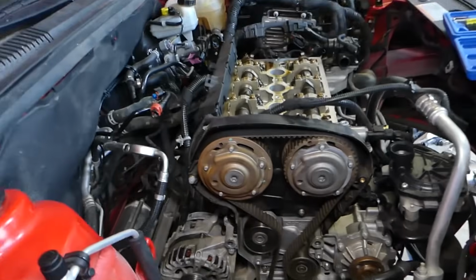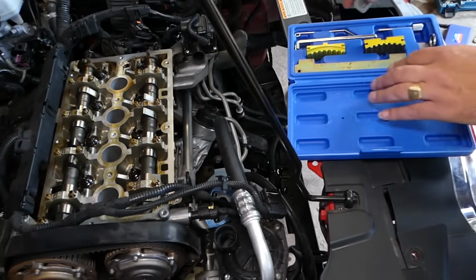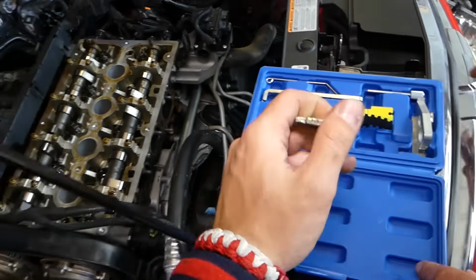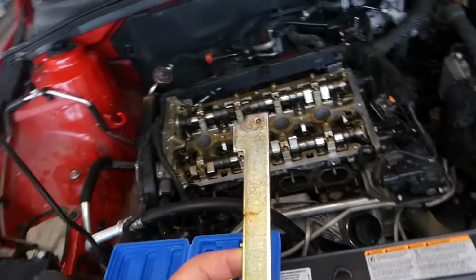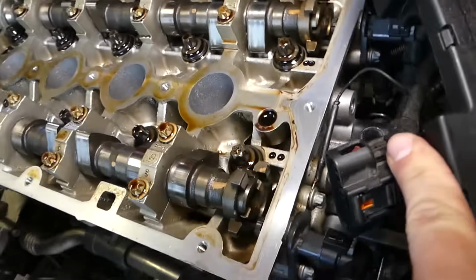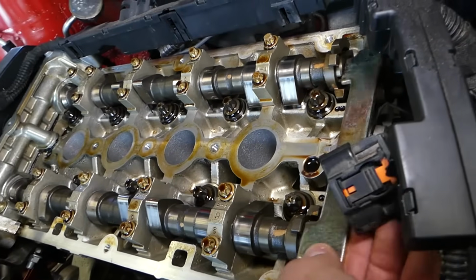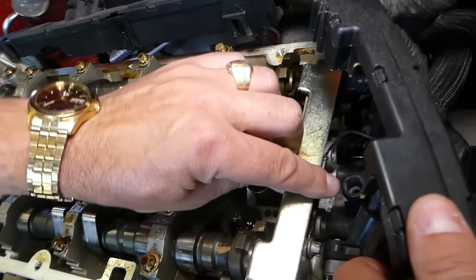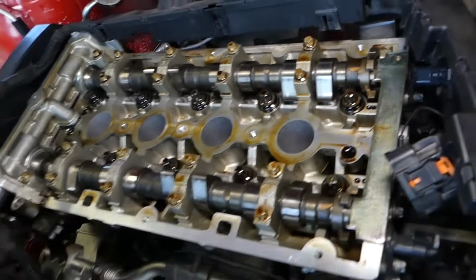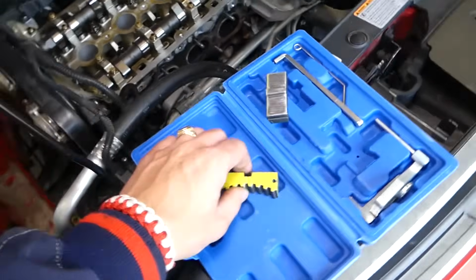Now on top, what we need to use, we have the tool. You can check out in the description of the video below where we got ours from. This is the tool for the camshafts lock. You can see the camshafts. Once you bring the engine to TDC, it has two canals lining up, and this tool needs to go in the camshafts like that. Perfect. Now the other two, we painted ours yellow so you can see a little bit better.